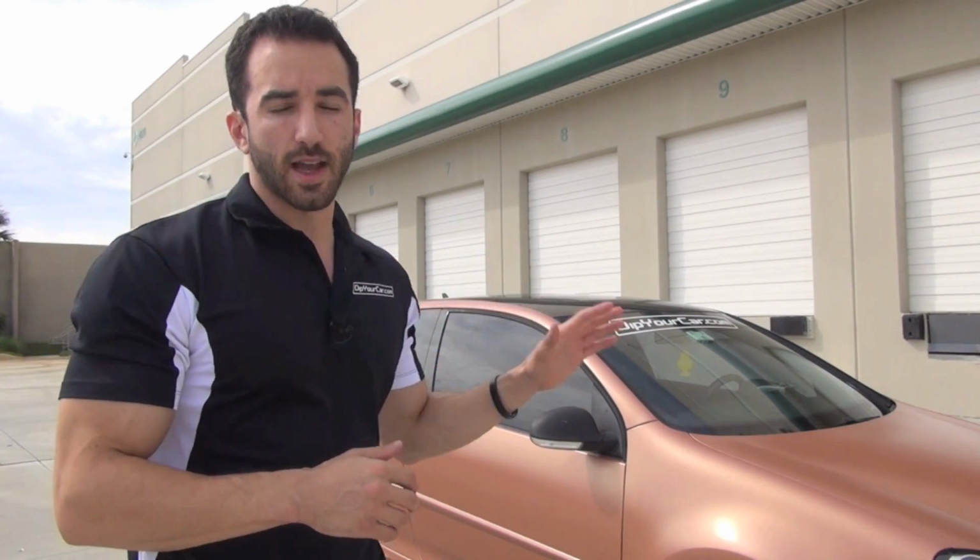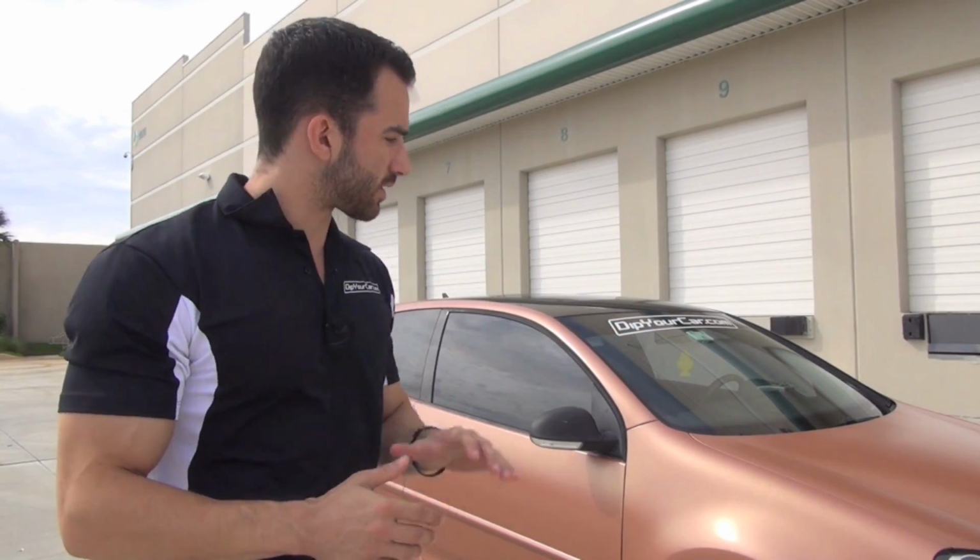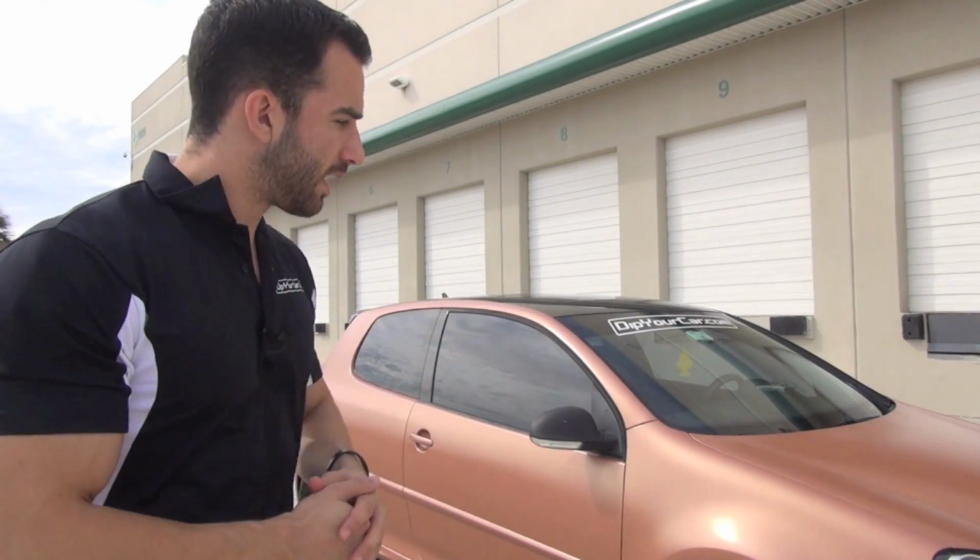We wanted to use that gold metalizer in a gallon. We've never used that before in a video, and we absolutely love the way that it came out. It gives the car a nice satin, because if you remember, the metalizer products are actually glossifier with the metal effect added. So the metalizer as a top coat added a nice satin finish, and there's a ton of gold metallic flake on it. We only did 1 coat of the gold metalizer as a top coat. If we would have went to 2 or 3 coats, it would have been even more metallic and more gold.